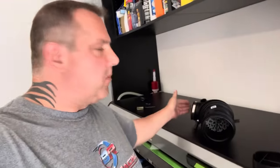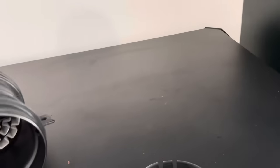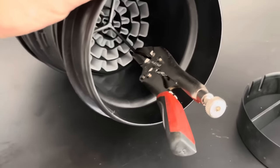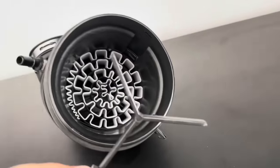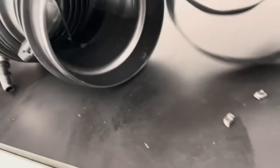I talked to Kelly on the phone. He told me he had pulled them out through the backside. On one side he cut all this out. I don't think I saw this on his video, but there's actually two little tabs on the big end. I'm going to try to take this out from the bigger side — just snap those off. I feel like pulling them out from this other side is going to be a little bit easier than going through the tube. We're just going to get some needle nose pliers and break all three of these tabs off. We broke all three tabs. We're just going to pop this restrictor piece here — I guess this holds it in. Now you just grab a hold of this and it comes out super easy, just no problem at all.